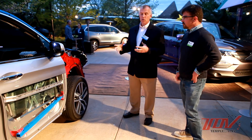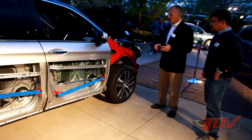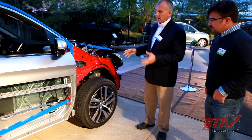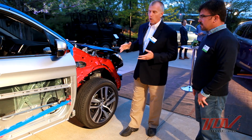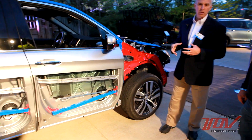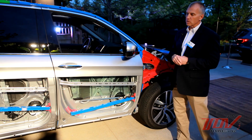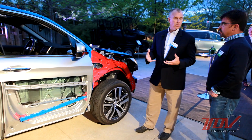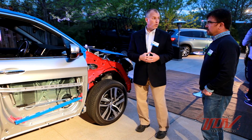Some of the key technologies in our safety performance — the red area here is our ACE body structure. It really is one of the load paths for several of the great crash tests, and it's designed to direct and manage the load paths. The blue area is the ultra high strength steel safety ring, and this is really what protects the occupants from all direction loading, but it's also lightweight — super strong, super rigid.